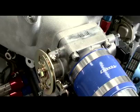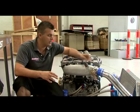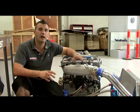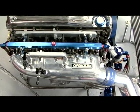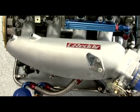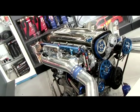After the intercooler and piping comes the throttle body and the plenum. Like the principle of rally cars running restrictors, the throttle body size determines how much power it can support. Greddy designed their aftermarket plenums to be able to fit larger throttle bodies as well as support a lot more extra power. They designed their plenums in the factory, tested on a flow bench, then used them on tried and proven drift, circuit, and drag cars in Japan. They designed their plenums to give perfect air cylinder distribution, so you get the right amount of air into every cylinder, and they also make it the correct volume to suit the engine and the application.